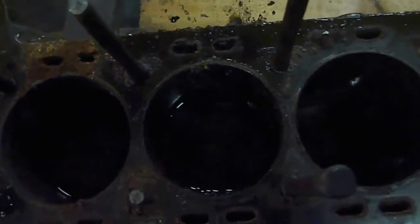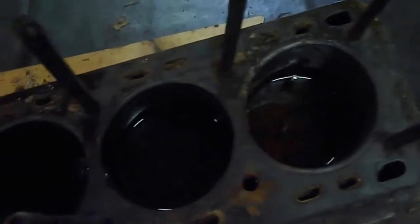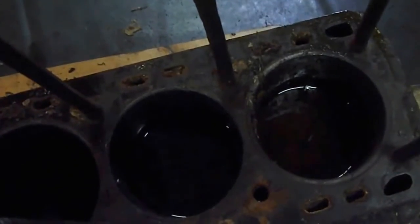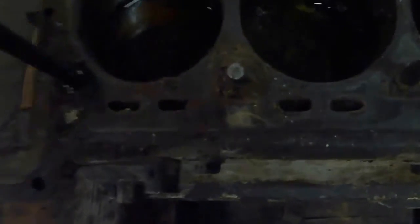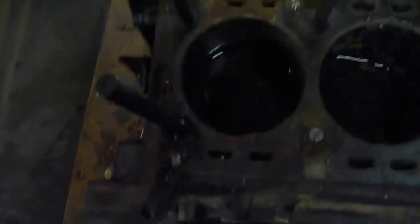What I've done now is I've actually put some fluid in there to try and see if it's run down past the skirts. They seem to be quite badly rusted, or the rings are very good, because the fluid's not dropping down much — it's gone down a little bit. I'll give it like 24 or 48 hours, and then I'll try and knock the pistons down the bore because they're further down.